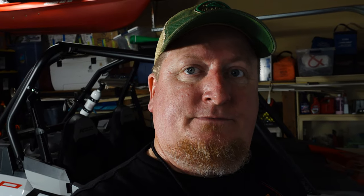Today we're doing what the owner's manual suggests you do right away after driving for a couple of hours — and that is adding antifreeze to a cold engine. Although brand new on the showroom floor it may seem full, once you've run it, the antifreeze has a chance to get the air out of the system and it tends to go down. Always do this on a cold engine and follow the owner's manual.